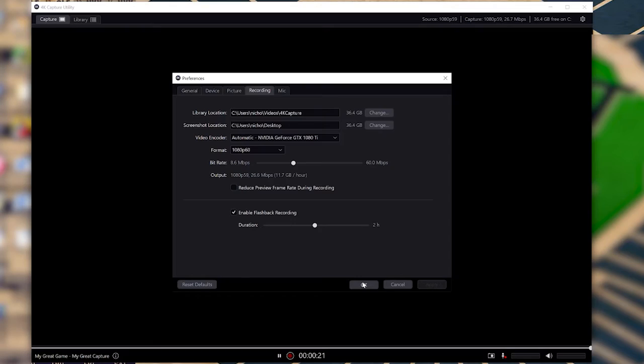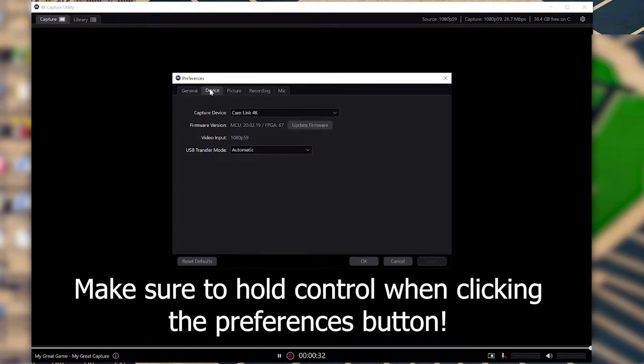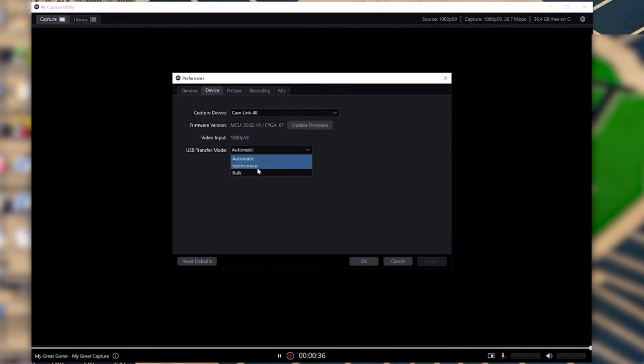Another potential fix is to change the USB transfer mode. You can do this using the 4K Capture Utility software, which you can download from the Elgato website. With the software open, hold down the Control key and click the gear in the top right corner. This will open up your preferences. Then select Device and change the USB transfer mode from Automatic to Isochronous,